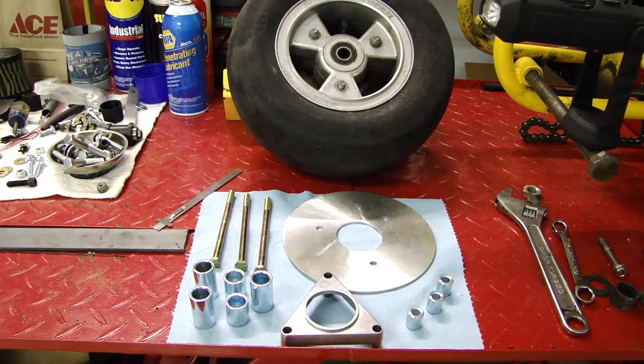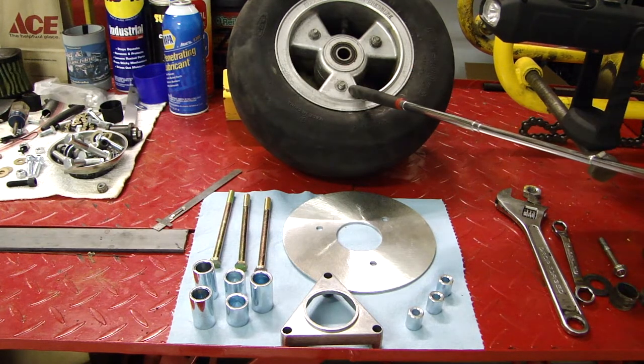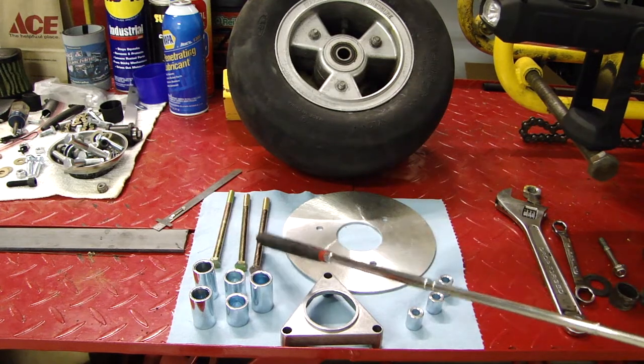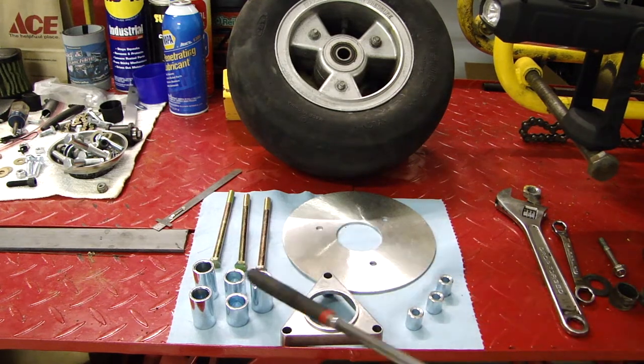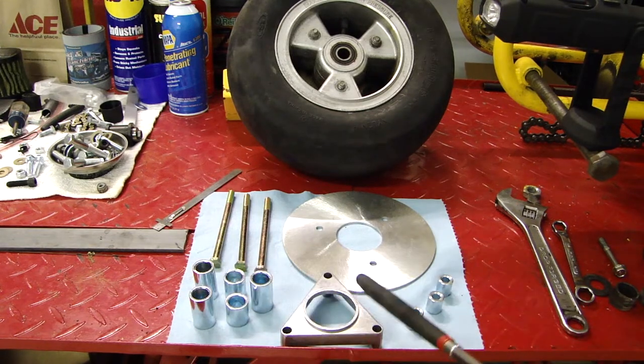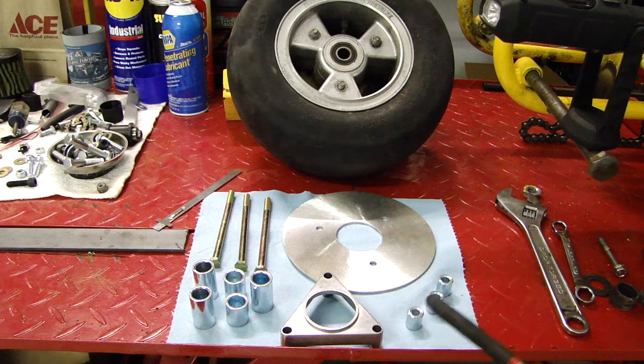What do we got here? Well, we got a hydraulic brake conversion about ready to go down, all being done on the scrub brake Temecula Bob frame. What we're starting with here is the TriStar wheel that came with the bike originally. We have new, longer, grade 8 5/16 bolts, some random wheel spacers that will have to be trimmed to size, a hub adapter, and another set of spacers to offset the hub adapter to fit the new rotor.